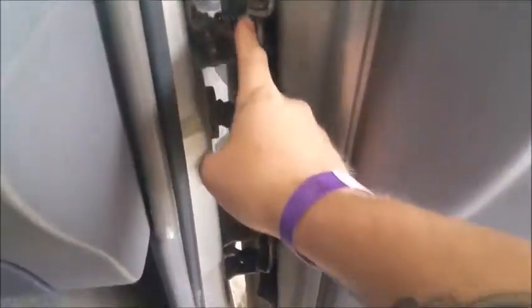Yeah, it kind of falls, and I don't know if you can see these right in here. These pins up here, there's a little pin that goes. You take those bushings off, drop the pins out, and replace them with new ones. Let's see, I got this little tool. I never used it before, but there's a spring in these hinges that helps keep the door open. I never put the other one back. This time I bought the tool, and I'll show it to you. We're gonna see if it works like they say.